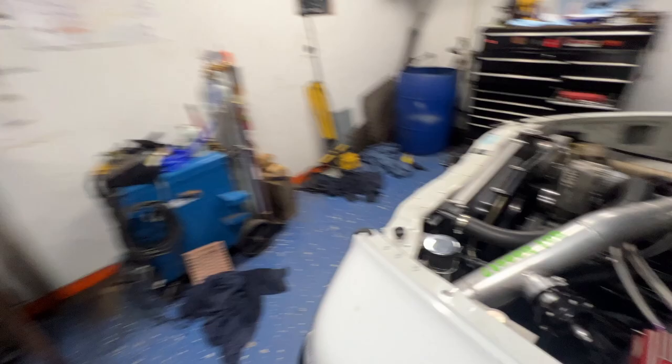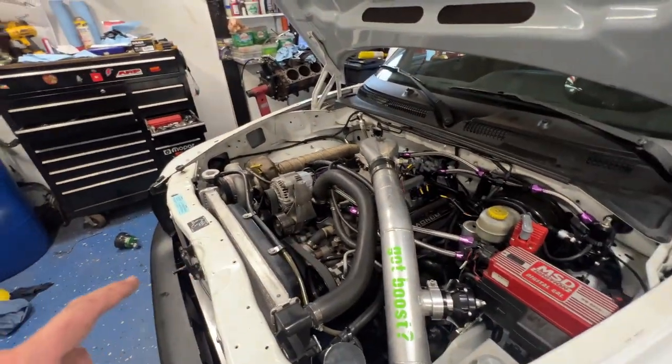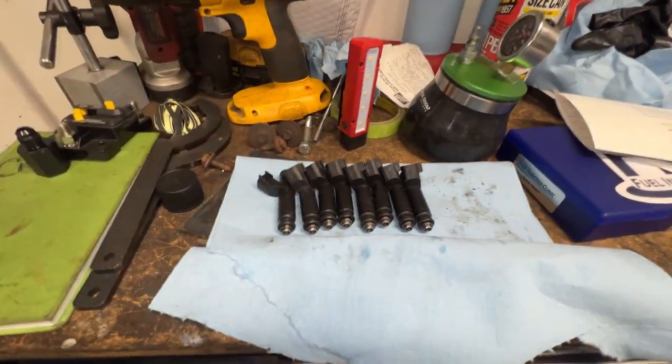Well, I'm happy with that. I did not have any leaks, by the way — no leaks out of my Amazon boost leak checker. So these guys have lived a long, long life. What that means is once I run all this 93 octane out of the truck, we're going to put in the first tank of E85. Luckily there are at least two E85 pumps here where I live, and one is really close. We're going to get this thing on the dyno and see what we can do — maybe turn it up to 14, 15 pounds and see what it does. But until next time, thank you for watching. Coming up, I've got a big project I just got into — the next video will go into that. Still has a turbo, so that's good news. Thanks for watching, see you guys next time.